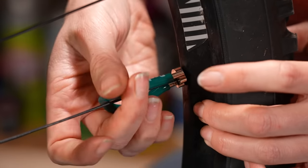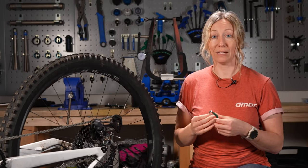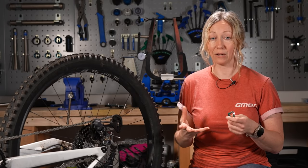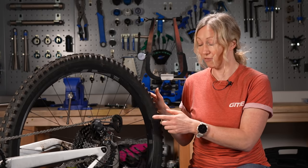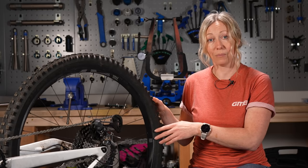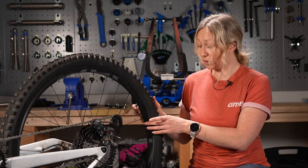What you're going to need is a spoke key. I've got a Park Tool workshop spoke key here, but you often have spoke keys on your multi-tools, so take a look at that. It will just tighten up the nipple and basically stop it from disappearing into the rim forever, because then you'd have to take your tire off and your rim tape off to get it back out, which you don't really want to do on a trail.